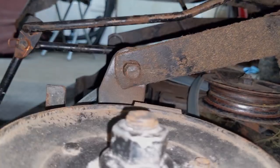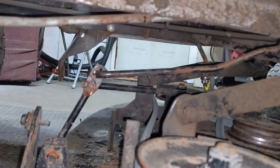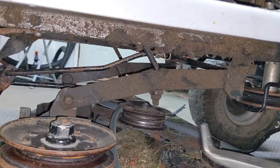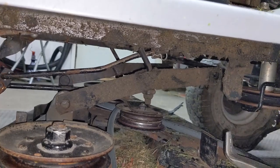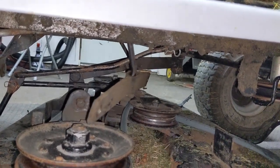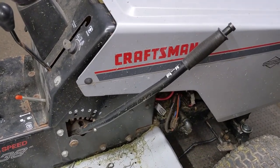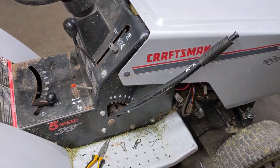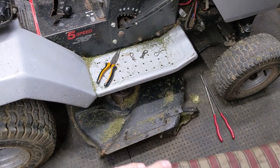Repeat all the same steps on the other side, rotating your pins — working smart not hard. Now that we have all our pins for the deck disconnected we still have the idler pulley rod to remove, but first we're going to remove the deck hanger. The deck hanger goes to the inside, so I'm just going to give this a little hit and then come in behind it and give it a little pull — simple as that. On this particular Craftsman riding mower we can see that on the deck height lever we have six different cutting positions.